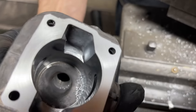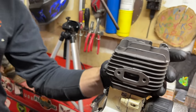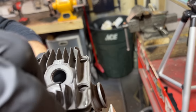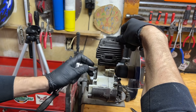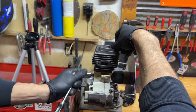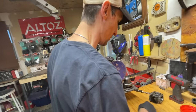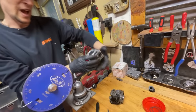The cuts before the final one don't matter as much — this is our finish height, doing it really nice. The less material you take off your last pass, the more even the finish. Looks good — I'd hire me. So there we go. Now we come and re-measure our squish clearance. Use a new piece of solder — I don't use the same piece again. I can feel from doing so many that we're right there, running it against the cylinder a bunch of times until you basically don't feel it anymore.